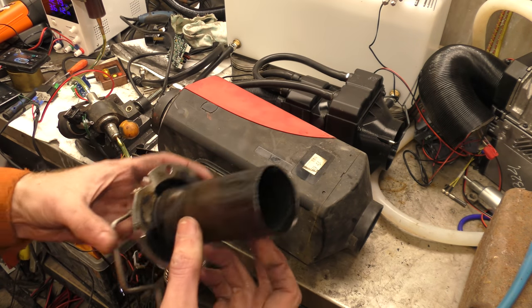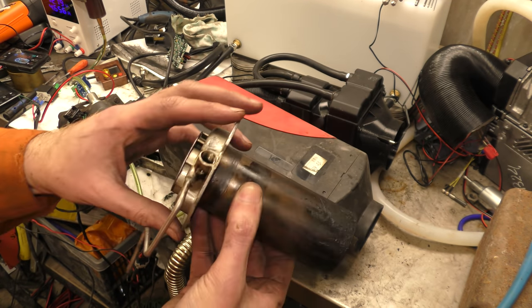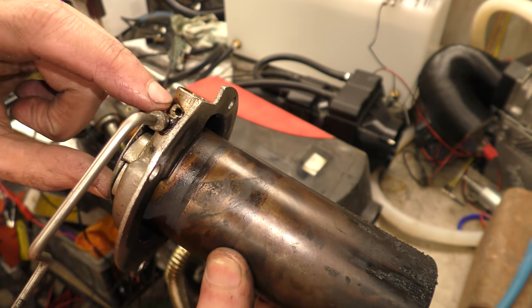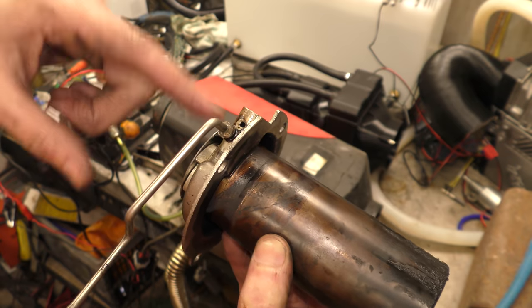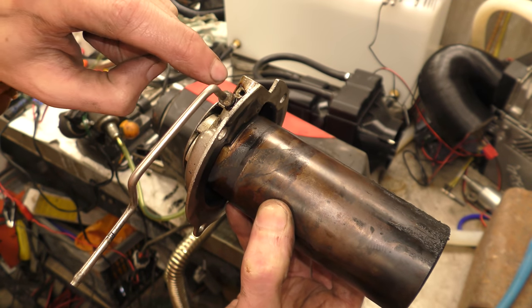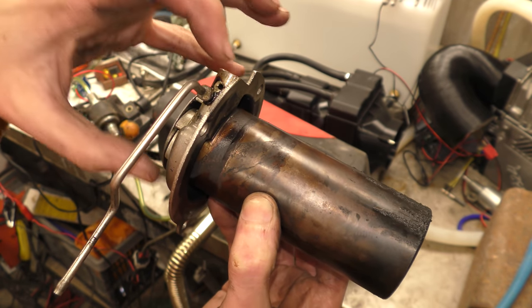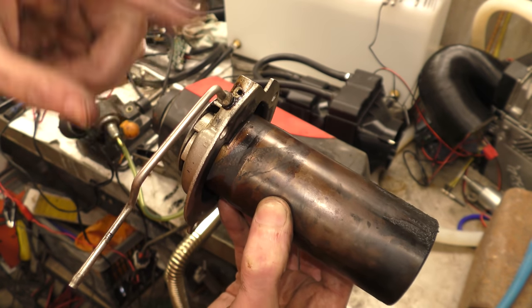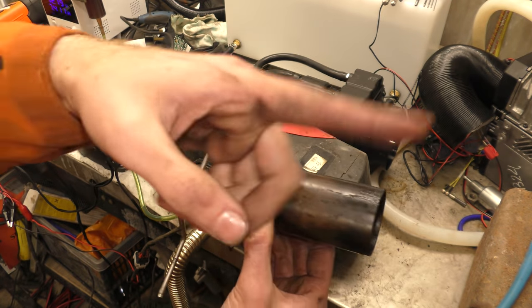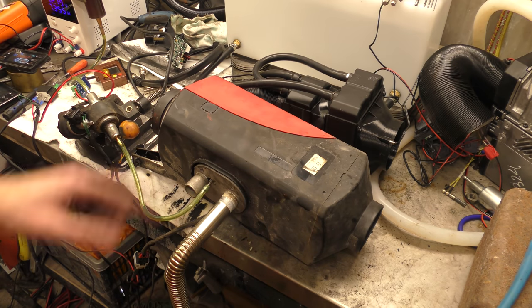So if your diesel heater does not start up and fires out nothing but white smoke, check your exhaust to make sure it's not blocked, and open your heater up and make sure that the hole in your burn chamber is clear. That is the flame front establishing hole - when it's doing its initial glow with a little bit of diesel, a lot of air goes through the main chamber but also a little bit goes in here to mix with the evaporating diesel and start the flame. Once you've got a flame in there, then the air through here mixes with the diesel and you have combustion. But if you don't get the flame front, it just keeps blowing combustion gases out past it and never gets a chance to ignite. White smoke, no light - check hole. Thanks for watching.